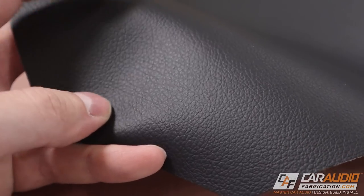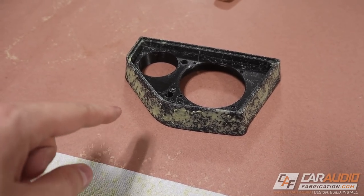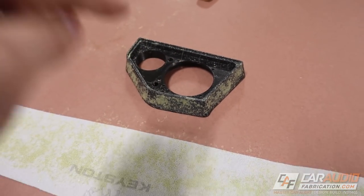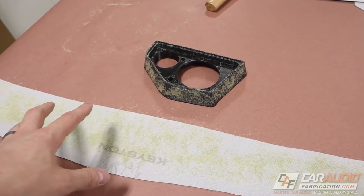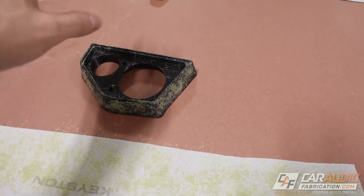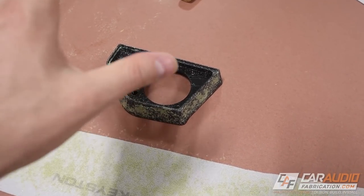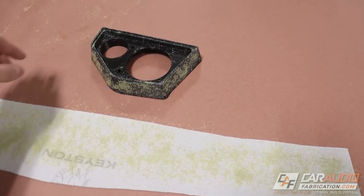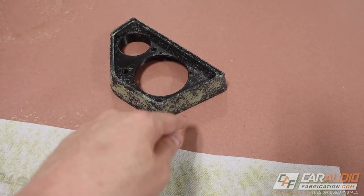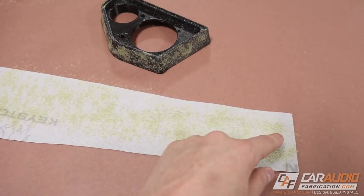For the upholstery on this project, I'm using this nice black vinyl that perfectly matches the grain on the dash. One of these pods had a lot of warping issues so I saved it as a practice piece, because once I go to wrap these I don't want to mess up my finished pieces. Rather than pulling a sheet of vinyl over the top with a really far draw — which can mess with the grain — I'm going to wrap it around this way, with the seam on the side that matches up with the A pillar so you'll never see it.